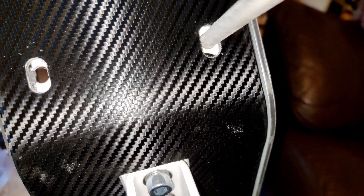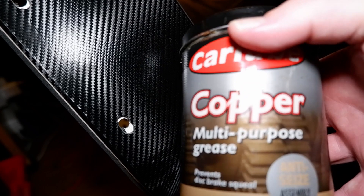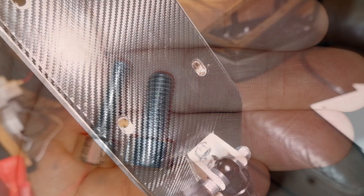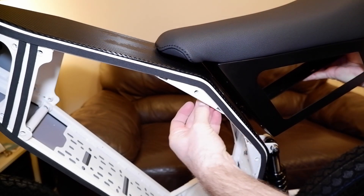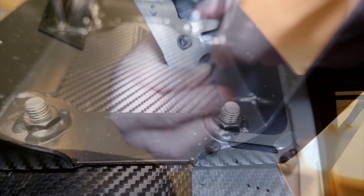First of all we've got to get a file and file a hole slightly bigger, because the powder coating just makes the hole a little bit too tight and the bolt won't go in. So give it a small bit of filing until the bolt is free to go up and down, then apply some copper grease to where you filed — because if you leave bare metal it's going to start rusting. I also changed the bolts from the 20mm M8s they come with to 25mm M8s, because they were a little bit short for my liking. Then all you do is do the four bolts up. The front of the seat sponge needs to be pushed down while you do the bolts, which is a bit awkward, but it's not that hard. Do the bolts up and the seat is on and it looks lovely.